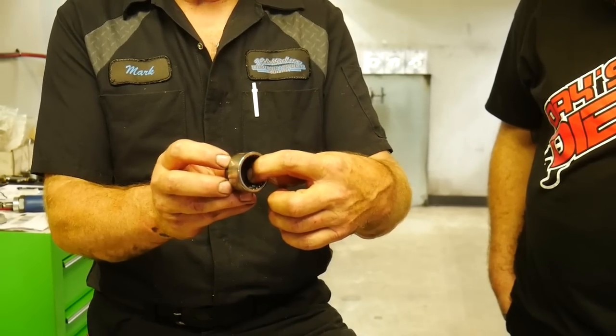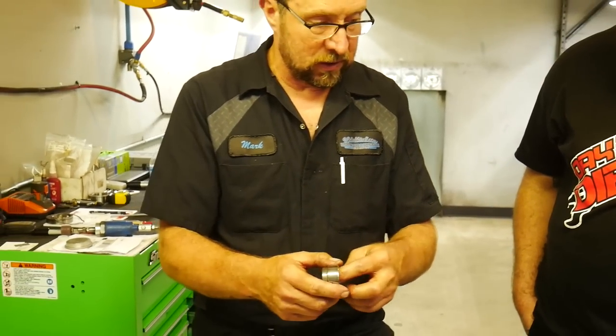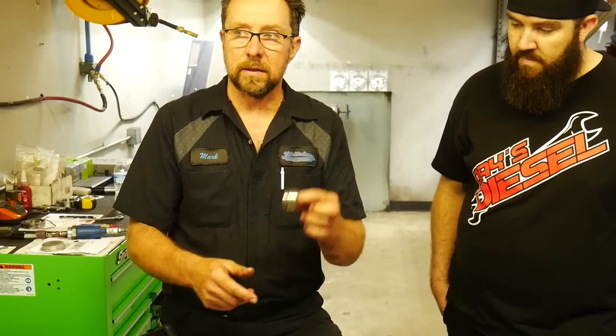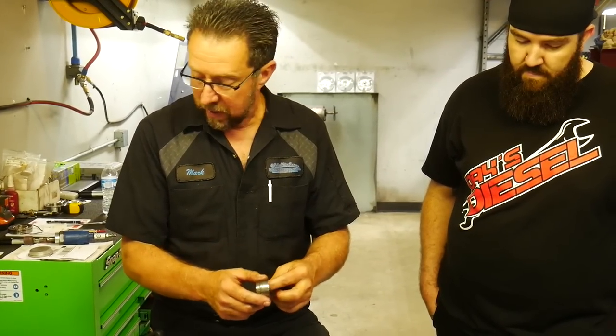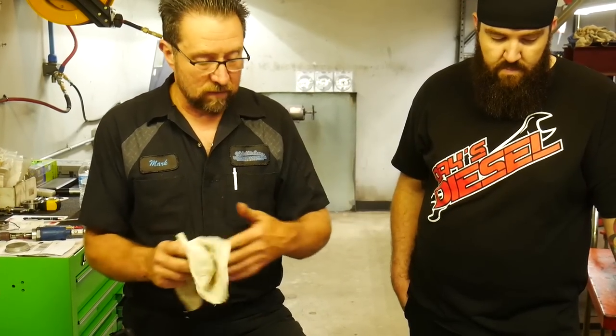And that's basically a freeze plug built right into the bearing. What'll end up happening is your trans will overfill the case and you'll take it in and they'll replace the input seal. And they didn't catch the fact that these bearings crack. Very common on the Magna cases, 7.5 and newer. They'll break their snap ring groove on the rear main shaft.